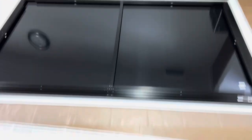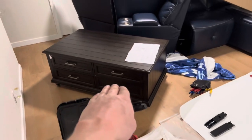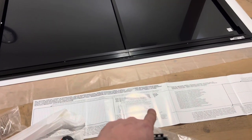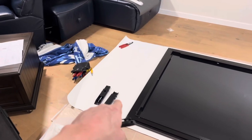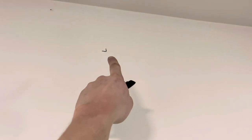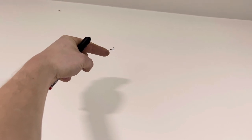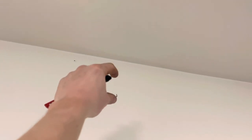To mount it you need this template — that is your center line. What we need to find out is the height of your stand. This one we're going to be using is about 19 and a half inches, which is perfect. This template has to be about 62 inches — the correct measurement is 61.89, I'm going to do it at 62 because there is adjustment on those arms. So 62 plus your stand height is the height of your template. If your stand is 24 inches, it's going to be pretty close to the ceiling because it's another four inches up.